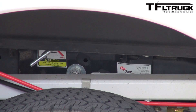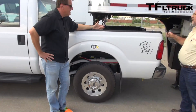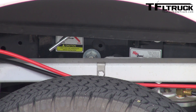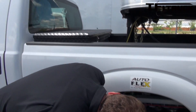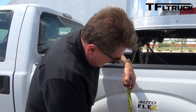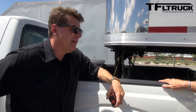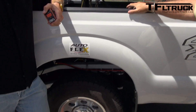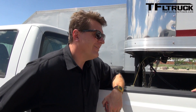Grabbed that lever. So now you're pumping up the air suspension. There's a compressor — the compressor came on. Now it knows what to do; it actually will level itself out. It senses the weight and puts more pressure in the airbag. All right, the moment of truth — we're at almost 70 psi. We were about 10 inches before, and look at that, we're at about 10 inches now. So it didn't squat with the trailer, and that's 10,000 pounds worth of trailer. Well, not all 10,000 pounds are on the back end — it's probably 20% of that, so we're looking at about 2,000 pounds. And it didn't squat a bit. That's pretty cool.